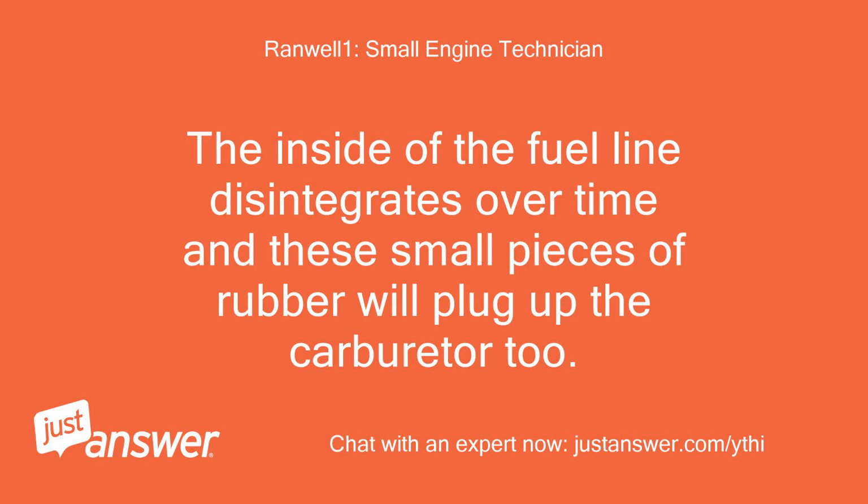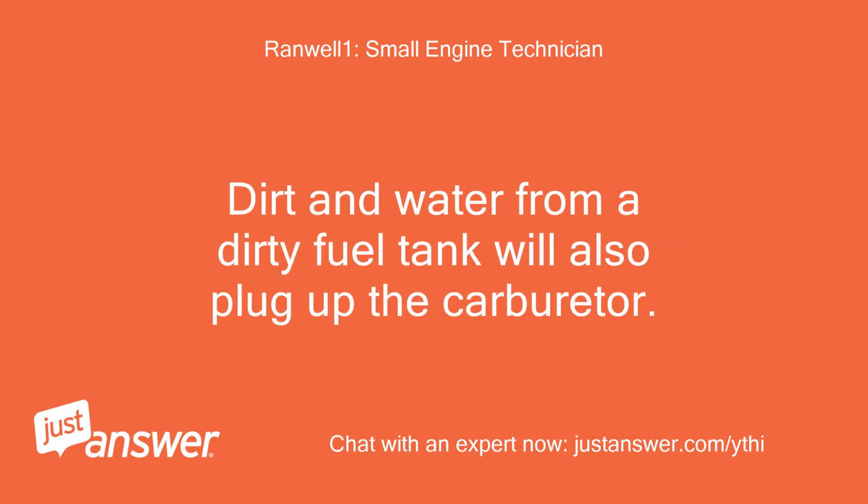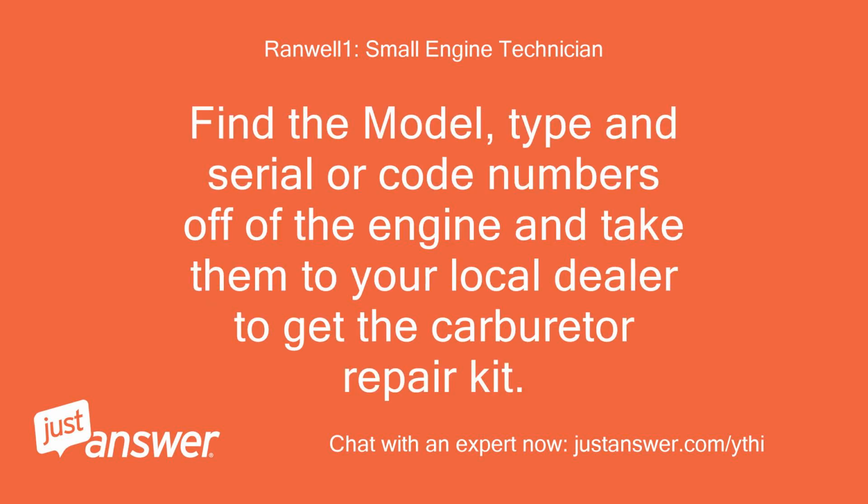The inside of the fuel line disintegrates over time, and these small pieces of rubber will plug up the carburetor too. Dirt and water from a dirty fuel tank will also plug up the carburetor. Find the model, type, and serial or code numbers off of the engine and take them to your local dealer to get the carburetor repair kit.